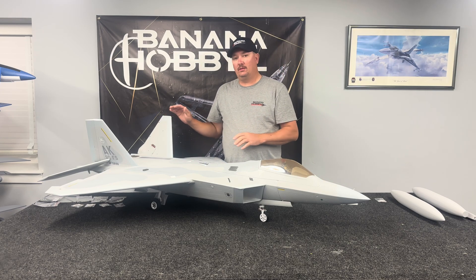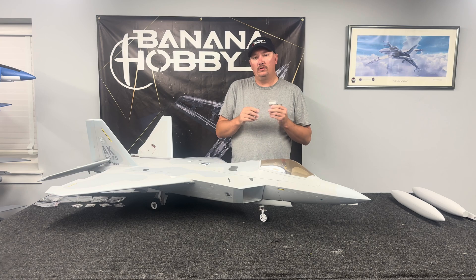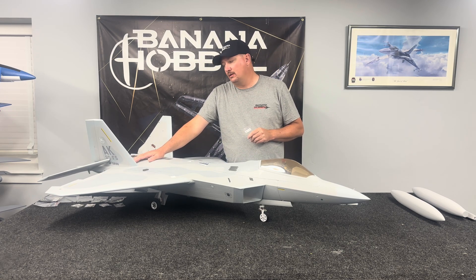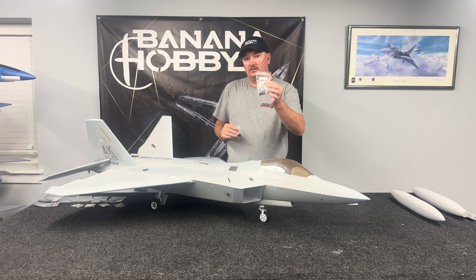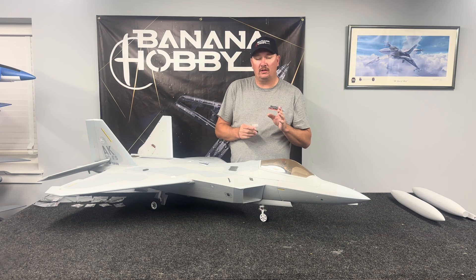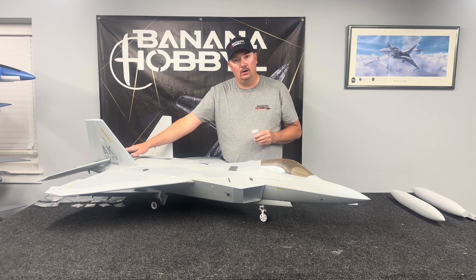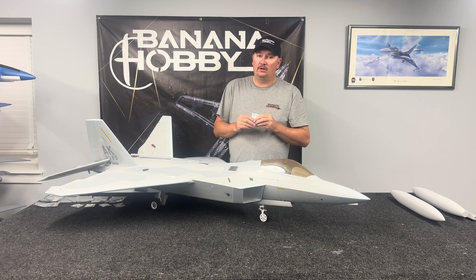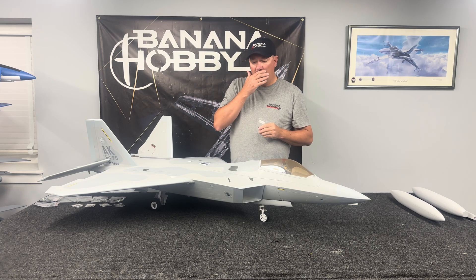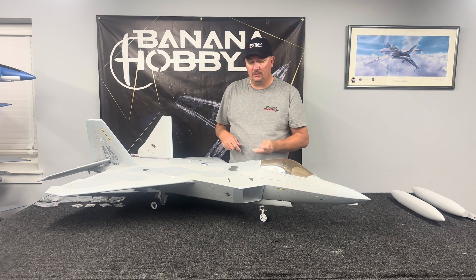We've also been finding that they provided two different size screws for the verticals — a 20 millimeter and a 15 millimeter hex screw. The manual says the front ones are 20 millimeter and the back ones are 15 millimeter. With every kit you get a spare set of every screw in the airplane. What we want you to do is use the 20 millimeter screws from that spare set and replace the 15 millimeter screws in the aft section of the verticals. The manual specifying 15 millimeter does not provide enough thread engagement, so the 20 millimeters work fantastic. Make sure you have all four 20 millimeters installed in the verts.